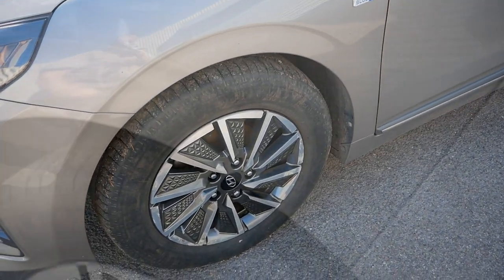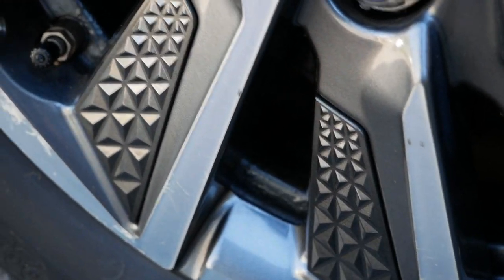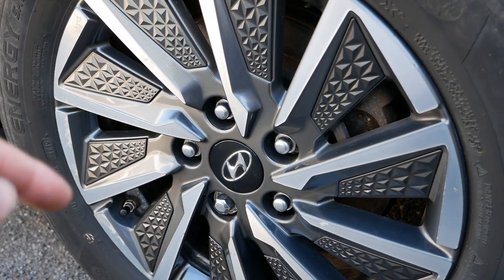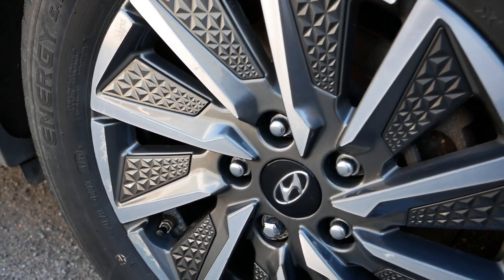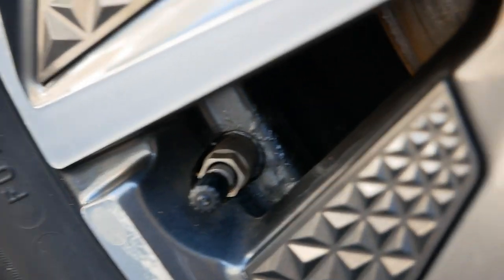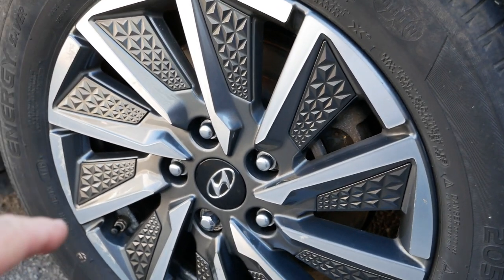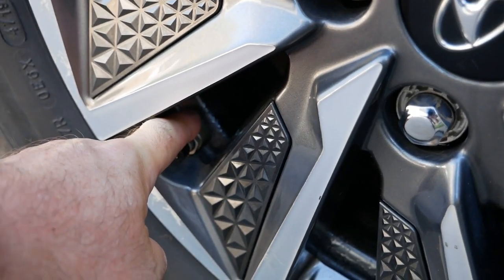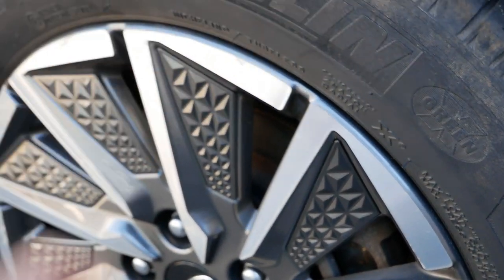One thing I've noticed is the wheels are starting to corrode on the inside, which is quite normal actually. Alloy wheels when they come from the factory aren't painted and lacquered the same on the inside as the outside — it's sort of an unfinished finish on the inside and they always corrode on the inside edges first. However this one is corroding quite badly around the valve stem, particularly for a three-year-old car. If it gets really bad it can start causing an air leak — if it corrodes on the inner edge and the bead isn't sitting properly, you can have air escaping.